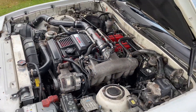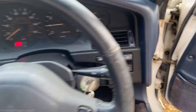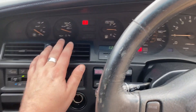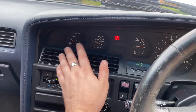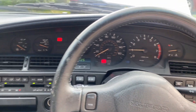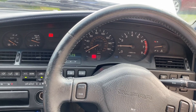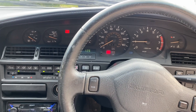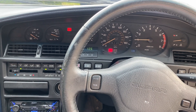Everything's now back on. If I bring you around and inside, we've recharged the system. The aircon is running, as you can see, and it is ice cold. I've got an air conditioning portable unit in my bedroom and it's as cold as that, which takes it down to about 16 or 17 degrees. Smugness has returned, albeit after lots of swearing and cursing. It's been recharged with just one of the air conditioning recharge systems from Halfords, and it's now sitting in the green on the gauges. It's cold in here — I'll count that as a win. We'll monitor it and see, but hopefully that means we've now got one of the only Mark III Supras in the UK with working air conditioning.